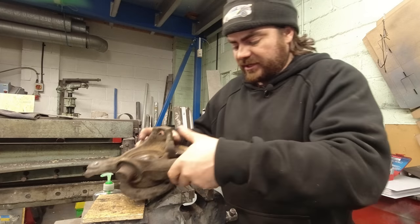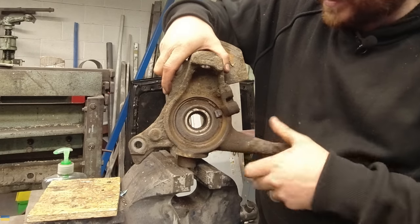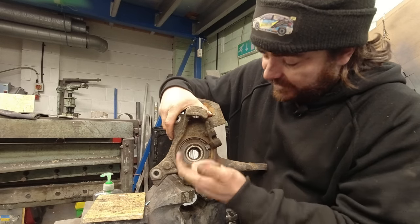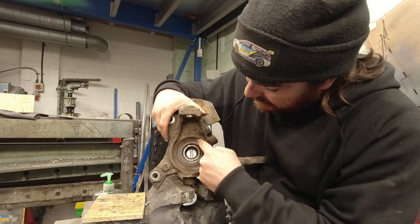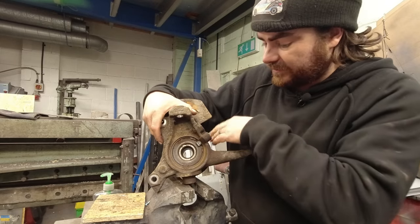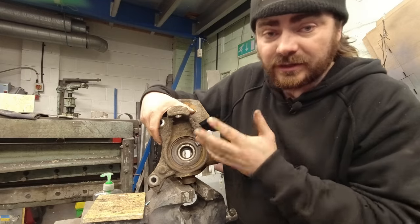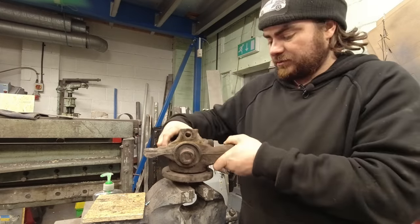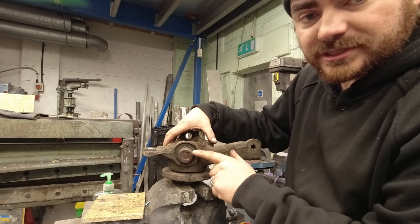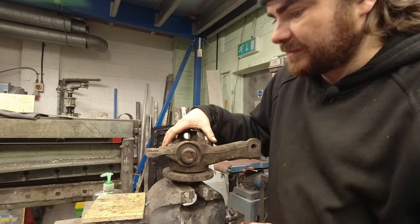What I'm going to have to do - I've had to break the ABS sensor, the remains of which are here, and I've got a new one. This bit here is the back of the hub flange on the front, so I need to press that out of the bearing first - I think that's the easiest thing to do, and it's the only way it can be done. Then there's a big circlip here which I'm hoping isn't rusted in, and then press the bearing out from the other side once the hub flange has been removed. Installation is a reversal of removal. Then I put the new ABS sensor in - the genuine Citroen one has arrived. Also on the end here, much like with the back of the wishbone, there's the shell from the inside of the old bottom pivot bearing - that needs to come off; it might come off with a couple of taps of the hammer as they're not normally press fit.